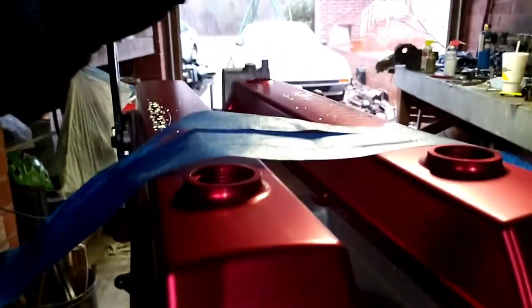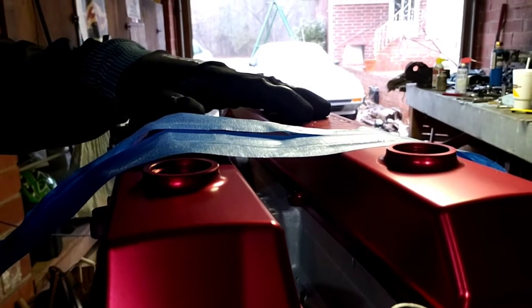I took the cams out because I still need to torque the head. I'll do that later on today. I don't know if I'll get that on video or not. I might not. It's not really that crazy of a deal. It's just going up to 80 foot-pounds in three different steps. And I just got a torque wrench, a GearWrench 83570, whatever the part number is. I really don't know. But that's what is right there. Kind of did some digging. That was one of the better ones, so I got it.